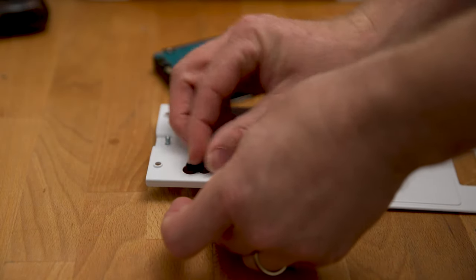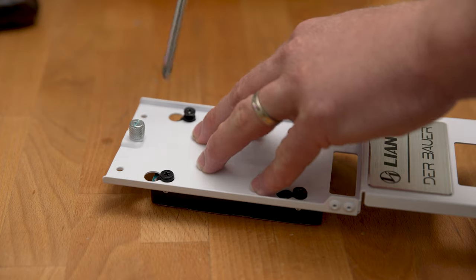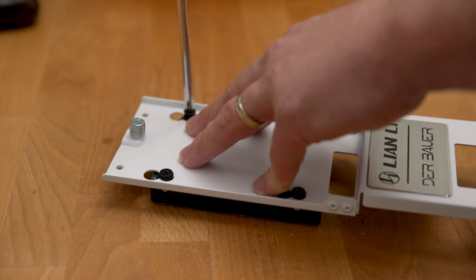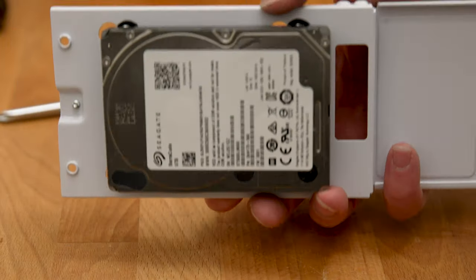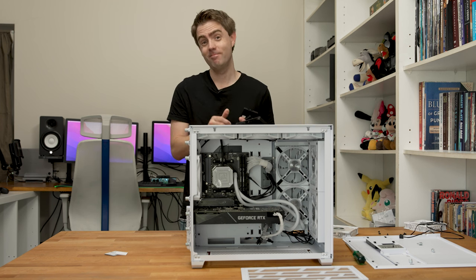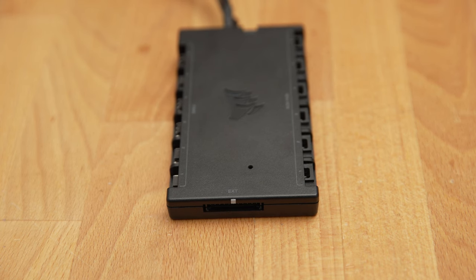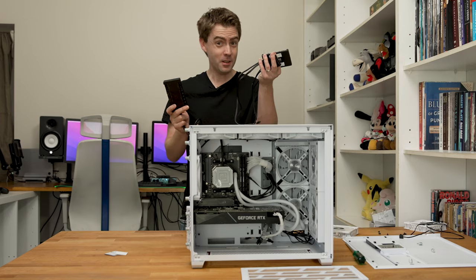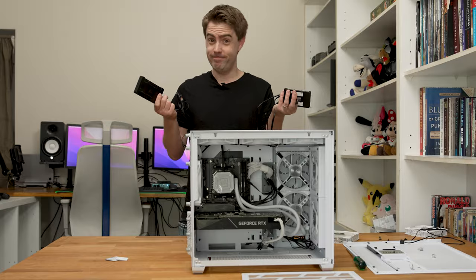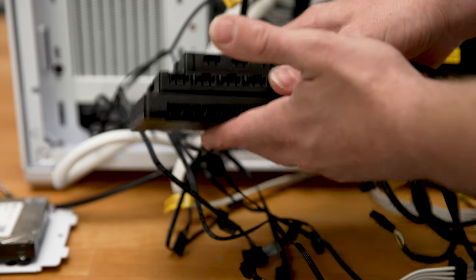I'm going to install my 5TB 2.5 inch hard drive onto the back plate of the case. Start by installing the vibration dampeners into the slots, line up the hard drive underneath and start screwing it in with the tiny little screws that came with the case. Now in order to power everything I need three hubs: the one that came with the cooler, one of the RGB hubs that came with the fans, and the Corsair Commander Pro. The cooler hub is the only one with the power port for the actual cooler, and the Commander Pro is the only one with USB hubs to power the other two. Plus with only about 6 ports and 11 fans in the case, you can do the math. Using the sticky tape that comes with each hub, I've stuck the Commander Pro and the included cooler hub to each other, and I'll do the same with one of the RGB hubs.